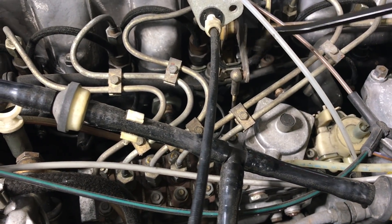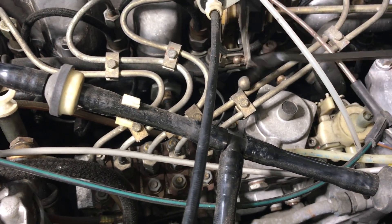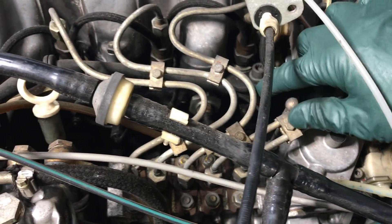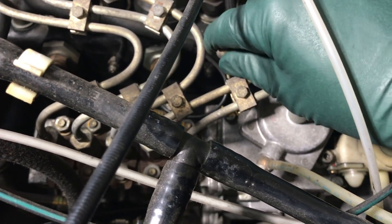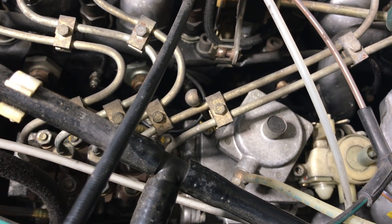This is my tool of choice here. I'm going to pop this linkage off right here like this, and then what you can do is grab a hold of it and pull up on it - pull all the way. I'm pulling hard up on that, and the engine should quit. Now, if the engine doesn't quit, I'm going to show you what might be wrong.